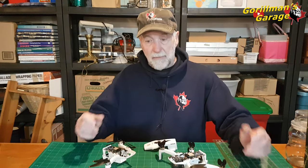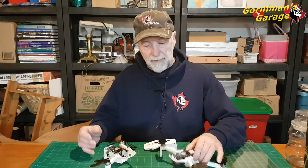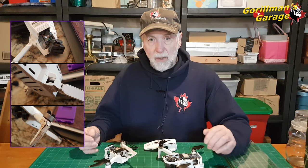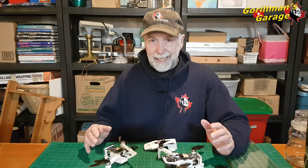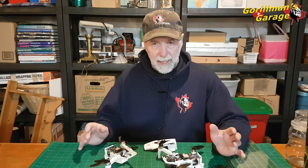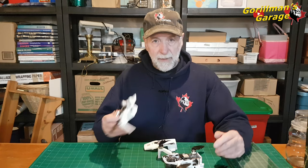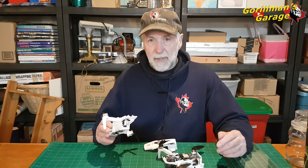We're in the workshop today for the aftermath of the crash. We assessed the damage and found we had a broken left rear arm and a cracked and broken gimbal mount. So how do we dismantle the Fimi X8 Mini? Simple, easily, without any damages, without getting too involved. Enough to either change out an arm with the motor very easily, or to remove the gimbal very easily. Anything more in depth would be a considerably bigger job.